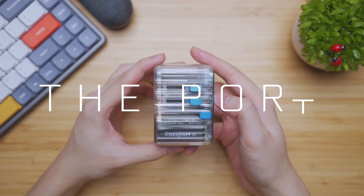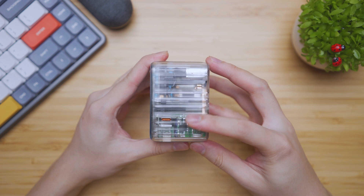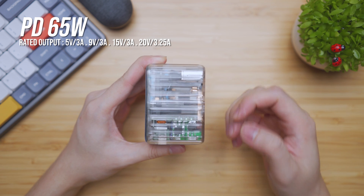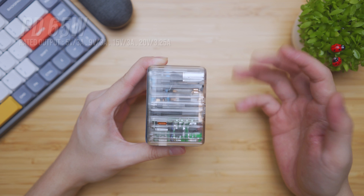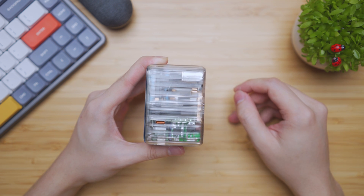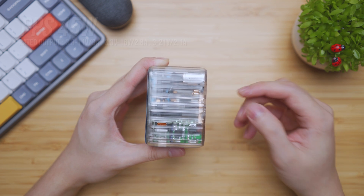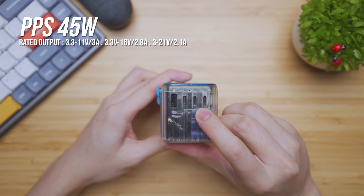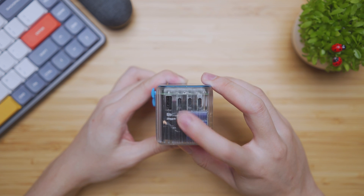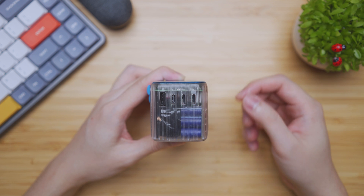On the right side is the main GAN charger unit capable of 65W power delivery output, good to power devices like Apple Silicon MacBooks — the M1s and future M2s and M3s — or any USB 4, Thunderbolt 3, or Thunderbolt 4 Windows-based devices. However, this port drops to 45W when any of the front ports are in use. The four bottom ports share 15W among them, good for charging smaller devices like photography and videography batteries, smartphones, and other low-powered USB devices.